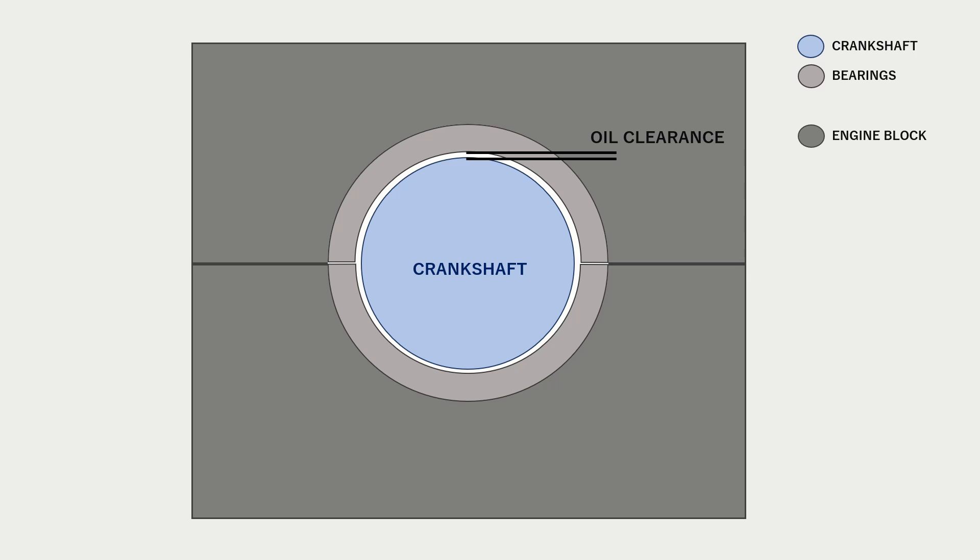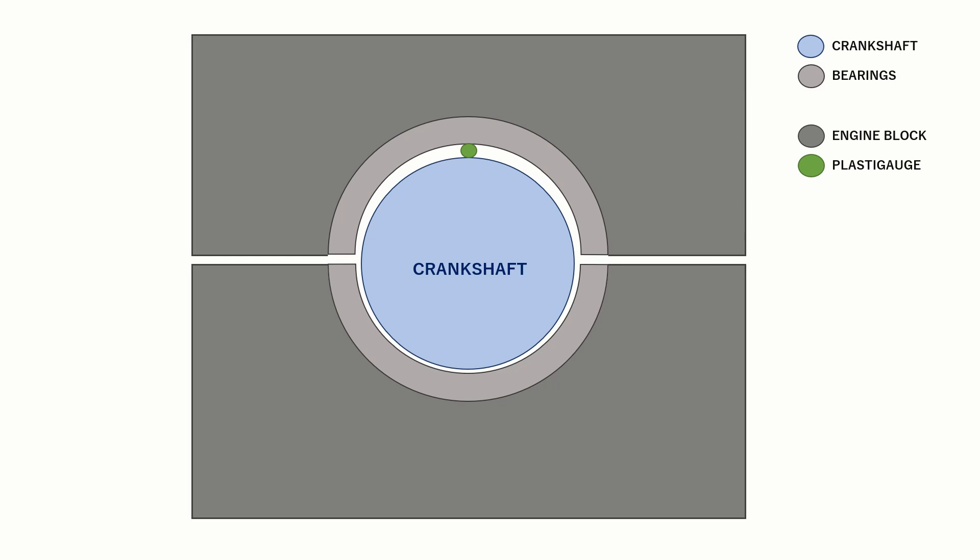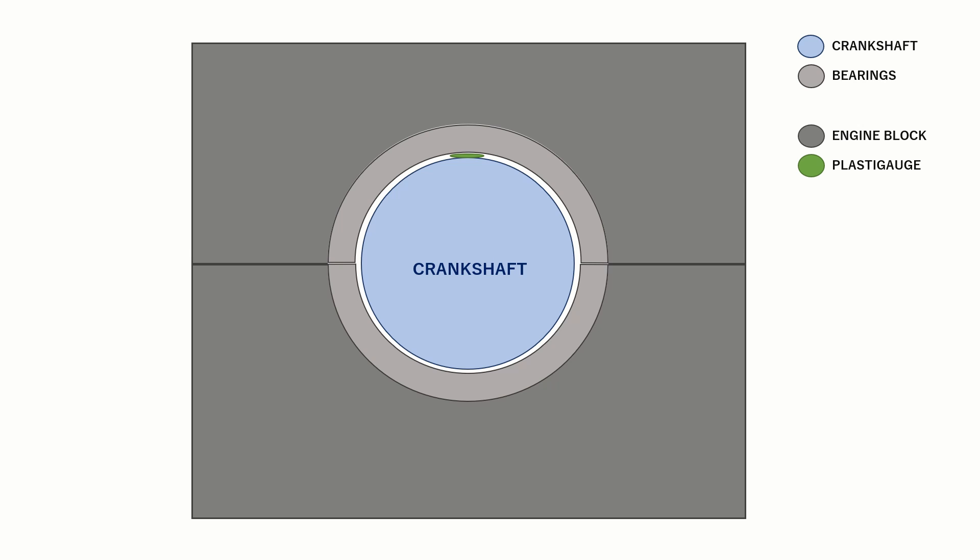This space is critical because it causes the crankshaft to glide on the oil. If this clearance isn't correct, it would cause metal-to-metal contact and your engine would grind itself to pieces while running. The way we check this clearance is by using plastigauge, which is placed on the bearing journal of the crankshaft. As we torque the girdle down, the plastigauge is deformed, and we then measure it to determine our oil clearance.